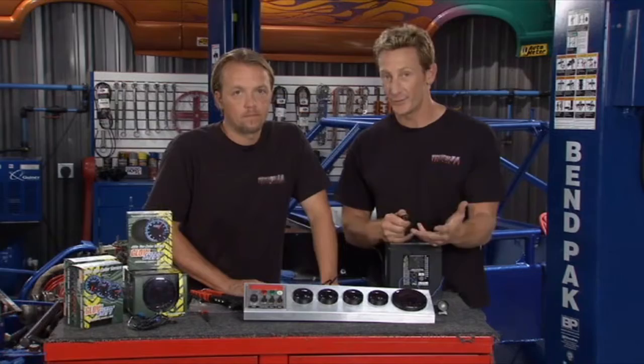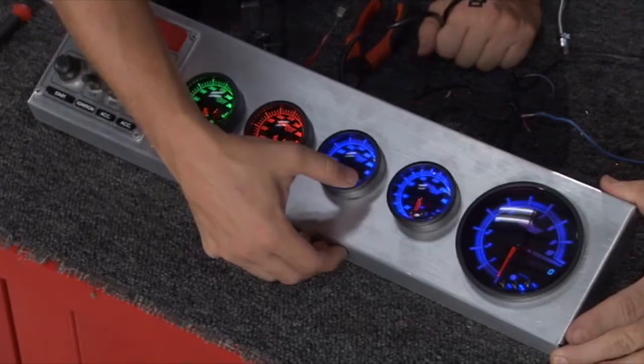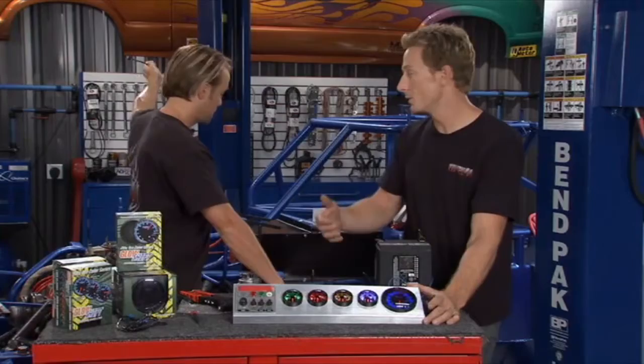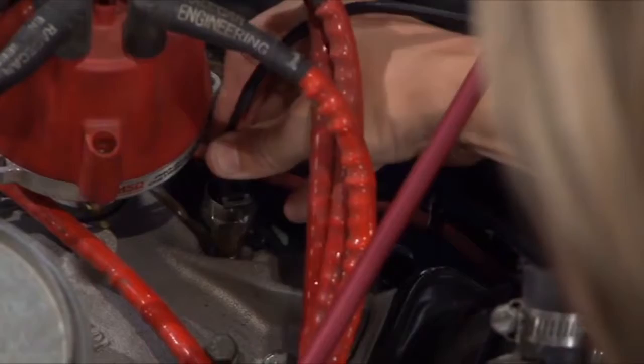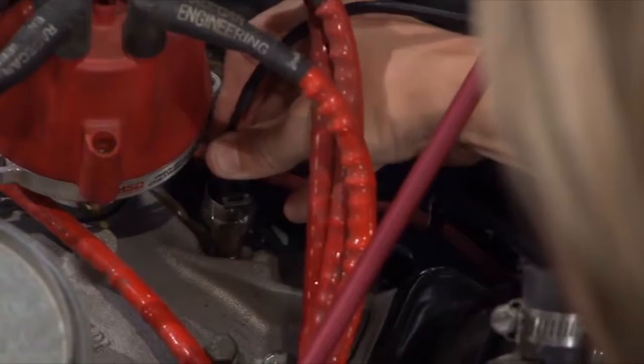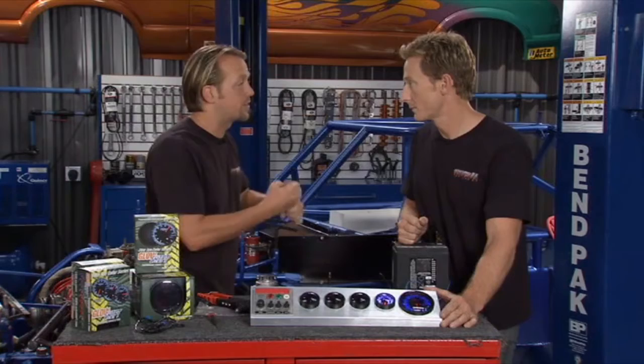Our new dash is done and ready to go inside the truck. The battery terminals aren't all hooked up yet, so before we do that let's show you how cool this looks when it's all lit up. Check out all the different colors — they come on as blue right there but you can change them. Now we notice that when you first hook it up you'll get flashing gauges — that means they're not fully connected to the sending unit. When there's a missing link in the chain, it'll flash like that. Matt went ahead and put the new oil pressure sending unit in earlier, and that stopped it blinking. Next we need to get everything else hooked up, bundle and insulate the leads from heat, and run them up to the back of the gauge cluster.